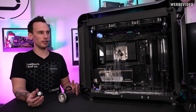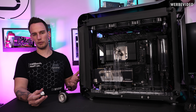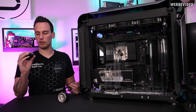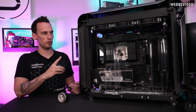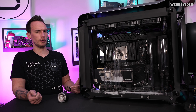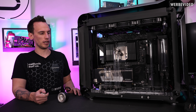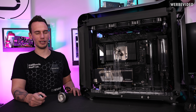I think this system has been running constantly for over a year, because as I said before I'm restarting maybe once a month or every two months — but only restarting, not powering off. So the bearing damage could have happened a long time ago and lasted a long time. I hope with the new pump it will also last again, maybe a year. Once we might build a new system, we'll find out. I've hooked up a different PSU to the back so we can easily fill the entire loop, check for leaks, and then I hope I can continue the last two days of my vacation.